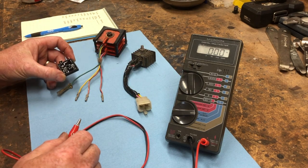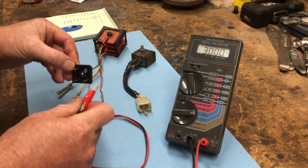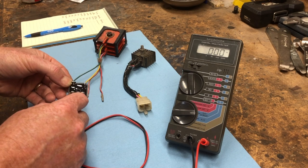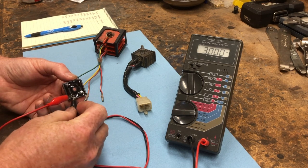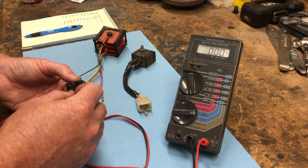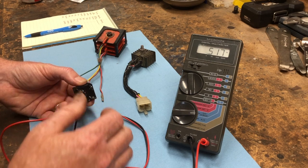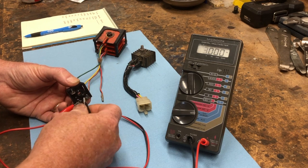If you're trying to check a solid state rectifier, it's the same procedure. The positive lead on this rectifier is this post — it's marked — and this is the negative post, or the green if you want to call it that. The check is done the same way: attach the positive lead to the negative post, or what would be the green post. These two other posts are the AC posts, which would be the same as your pink or yellow wire. If I connect that up, I get about a half a volt drop to either one of those posts.